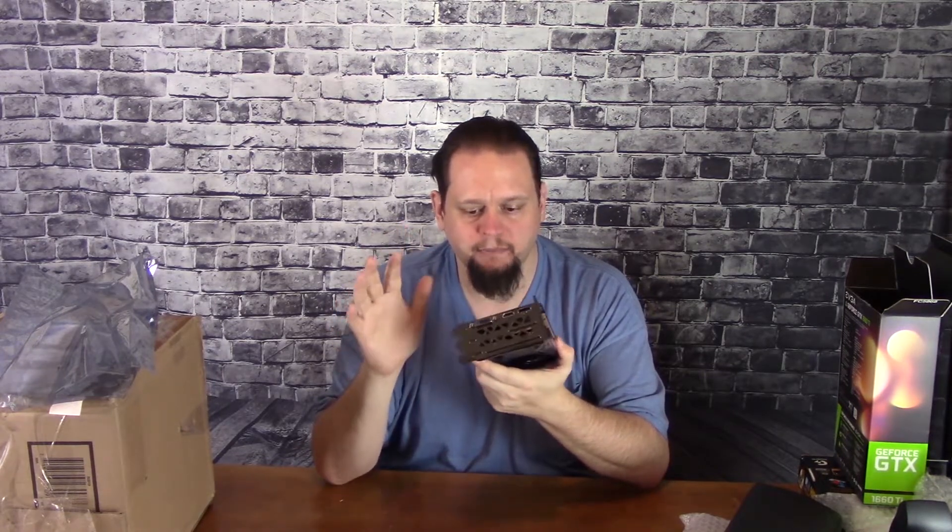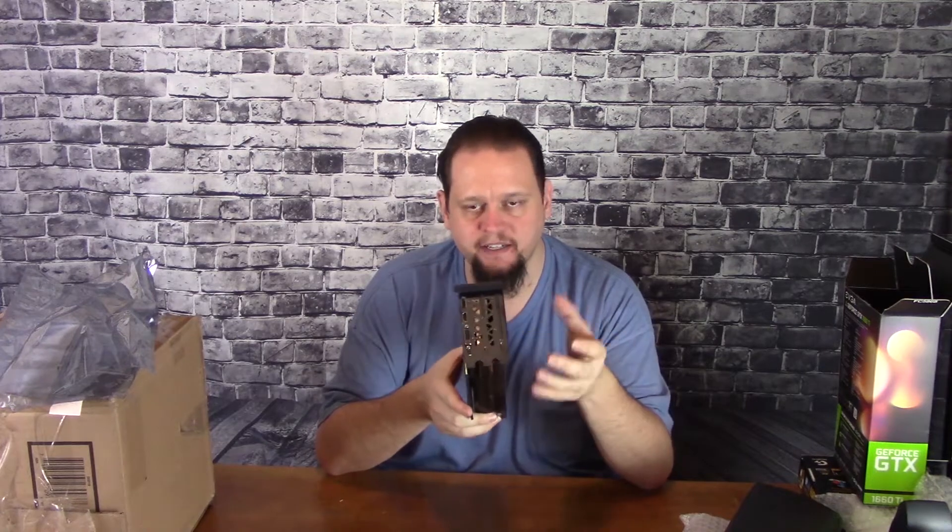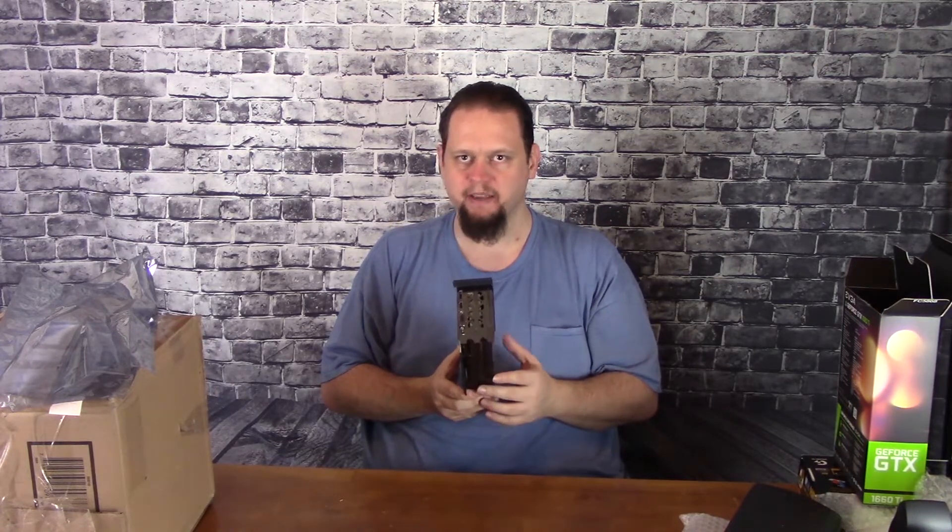So if you're looking to do more than one GPU — one thing: it does not have SLI capability, so you will not be able to SLI two of them. Do not waste your money buying two thinking you'll be able to SLI them. However, there are other things you can use multiple GPUs for, such as mining. But keep in mind the card takes up three slots, so when you plug it into the PCI Express it's got to have enough clearance. If your machine has PCI Express lanes too closely together, you won't be able to plug in more than one graphics card, or you'll be reduced in the number you can fit even with three or four slots.